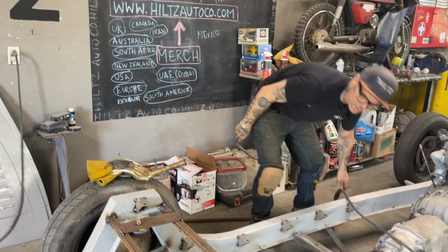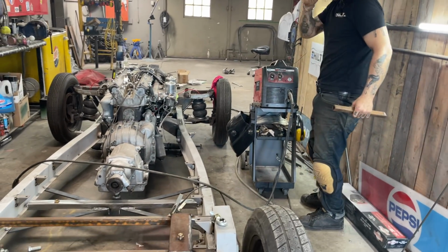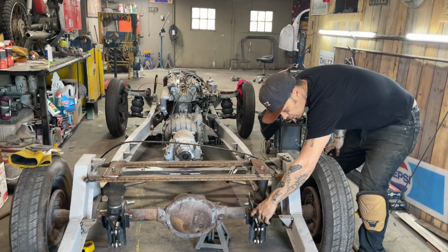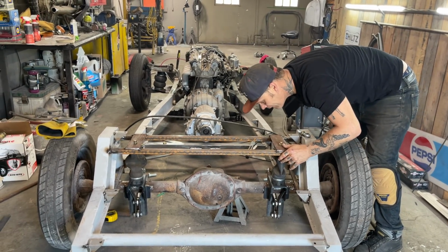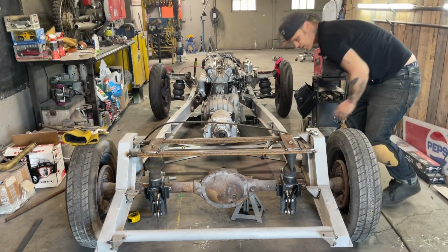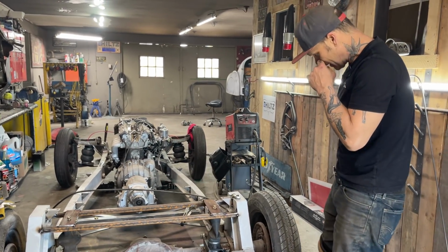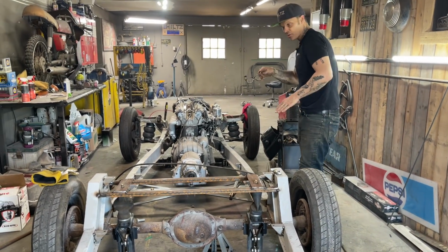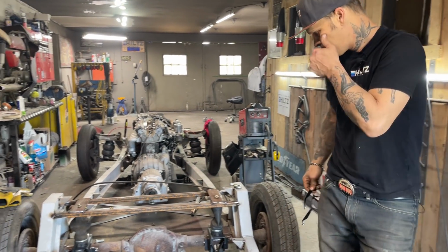Now, as we get looking at this, can't let anything move up and down. Cannot do that, that's for sure. But what's going on is, now we know this can be moved in or out on the rear end at any time. This is where it's setting right here. The rear end's going to be taken out, but this is the bracket for the airbag. And we have the bracket down there for the hairpin. So now the rear end just has to come in and sit in place because we know where everything else goes. I'm going to look this stuff over. If it's tight and right, I'm going to cruise on. If it's not, I'll take it apart and we'll fix it and I'll show you tomorrow.